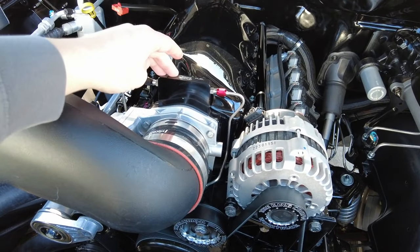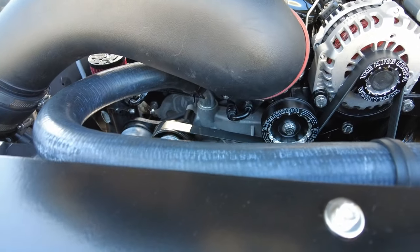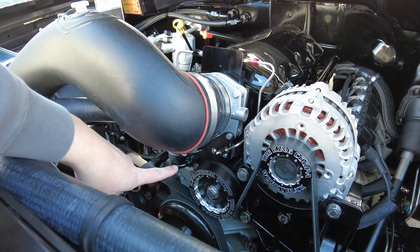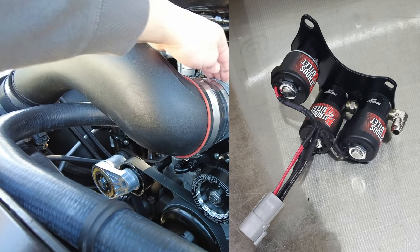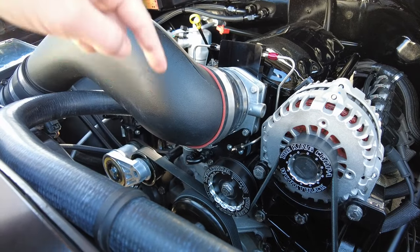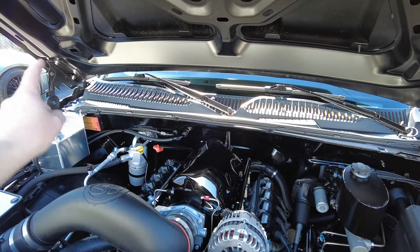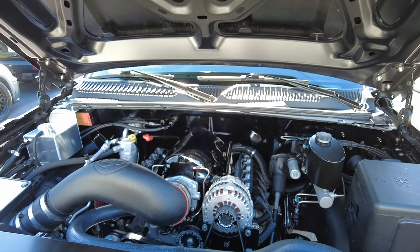Here is our nitrous outlet plate. This is where our nitrous and fuel get injected into the intake. It might be a little tough to see, but down here is a custom bracket I designed in AutoCAD. This holds my nitrous solenoid, purge solenoid, and fuel solenoid, turned backwards up underneath the intake. And right here is this 180 degree bend AN fitting that goes underneath the intake and then up the firewall. That is where our four purge ports come out. So I divided it by four. There's one port, two, three, and four. Just to add a little extra show.